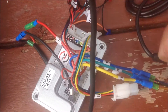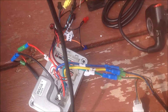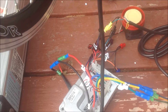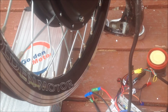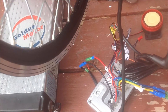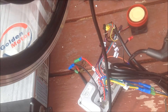Okay, I got it unplugged. So now from the motor we only have the phase wires hooked up — recall this wheel had failed hall sensors. We're going to turn the battery on. There are the two beeps to indicate that the hall sensors are unplugged, which was what we intended. And now when you turn the throttle — an abrupt start — but the wheel turns. So now the controller is running in sensorless mode. If you were out on the road and one of your hall sensors failed, you could just unplug the hall sensor plug and be on your way.